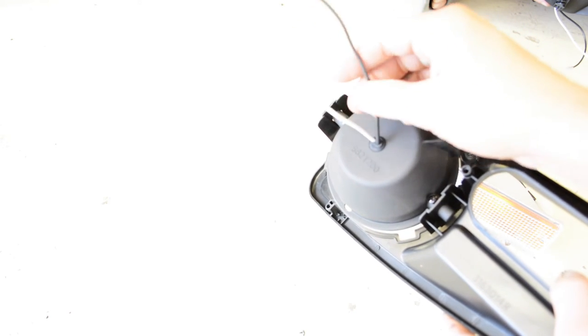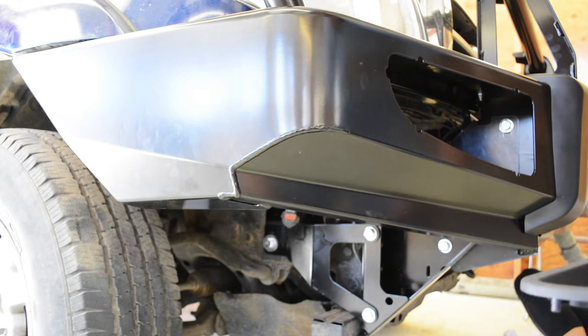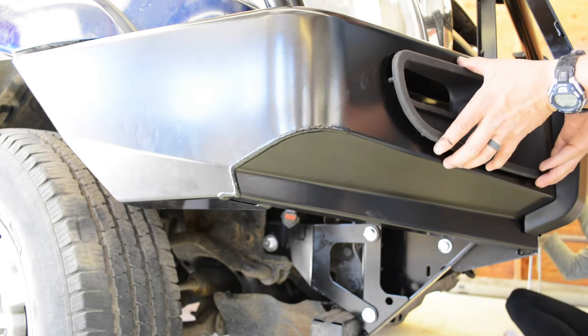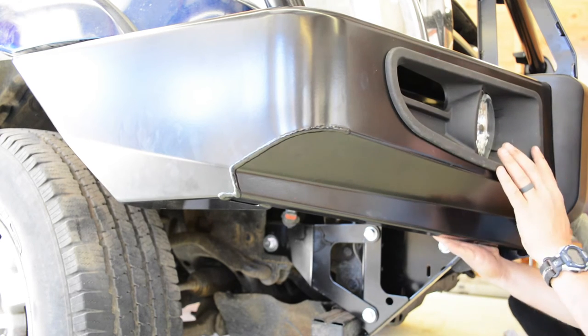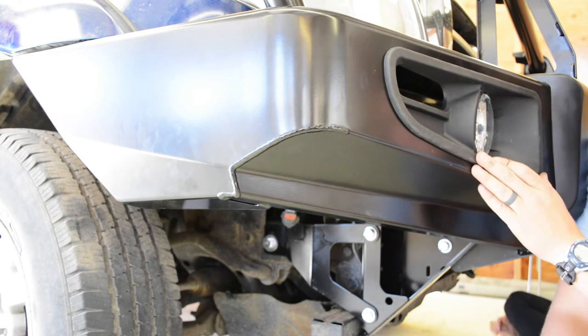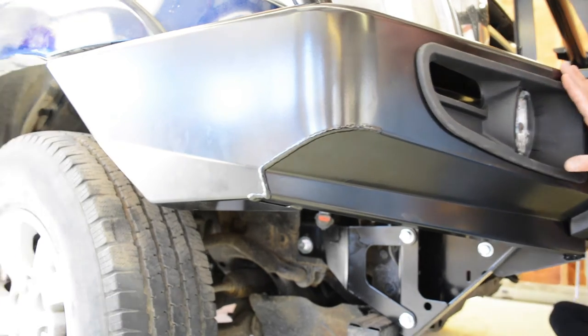And then your white wire here. If you're not familiar with doing electrical, find someone that is. Otherwise, you should be able to figure these out. It's pretty basic. When you attach the blinkers, it is also attaching this mounting kit. So slide right in, just like that. And there's a number of screws that you screw in from the back. And the instructions are pretty clear. And then use your signal.